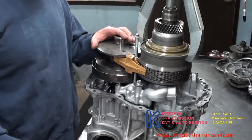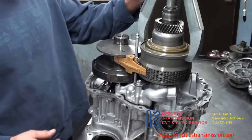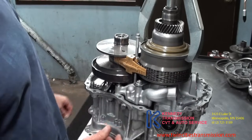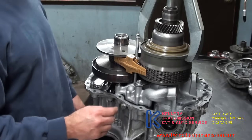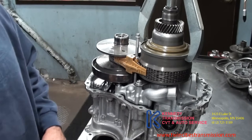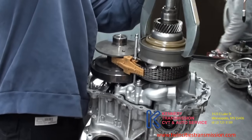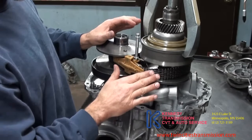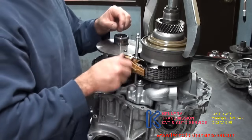Another day — I'm going to finish taking this apart. I've got a pull around the secondary, so what I'm going to do is lift up, take these guides off the pins, take the chain off, and then pull the pulleys out. I'm going to get the pinion hold retainer and the diff — take everything apart. Do not get your fingers in here in case this slips. It will crush your finger right off. Try and stay away from that.